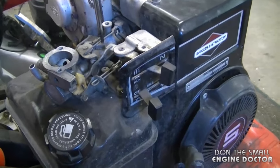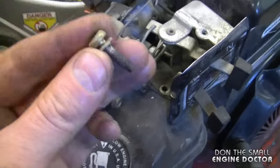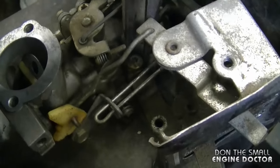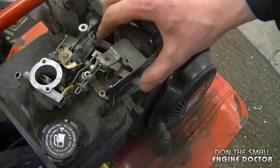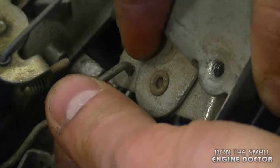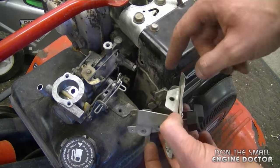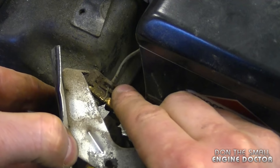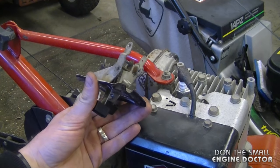What's going to happen now is the whole choke and throttle assembly will come off, so you'll want to remove these screws completely. I'm going to remove this one with a pair of needle nose pliers. Take note of where all the linkages are before you remove this part. To get this linkage off I'm just going to tilt it like this. Now all that's left holding this is the switch wire over here — just push down on this part and it's going to slide right out. And now you've got this part off completely.